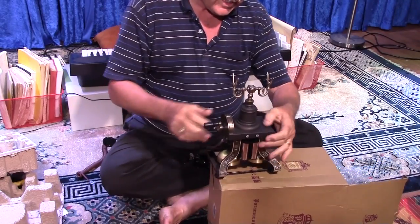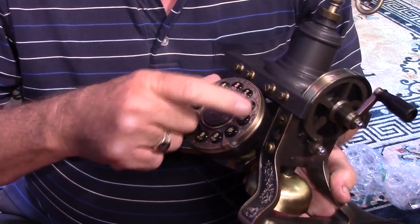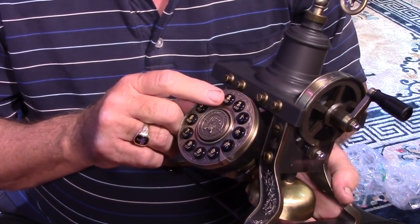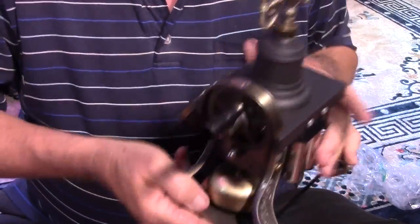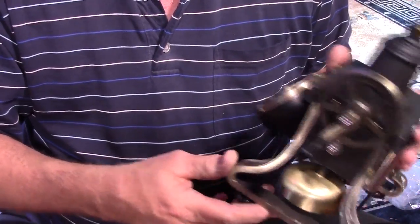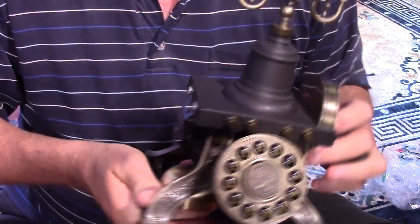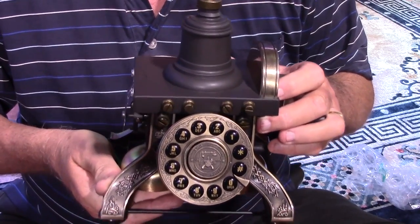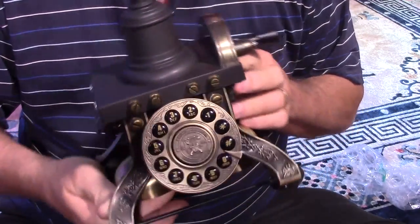This is cute, though it doesn't really do anything. I think that some words are in order concerning the buttons here. Some people have been unhappy about the buttons and wanted a real rotary dial. But we really have to remember that the original versions of this phone had no dial, no buttons — nothing. There was no direct dialing in those days. You would crank the handle, which would turn a generator, sending a voltage down to the office and alerting a switchboard operator that you wanted to connect. Then you would be manually connected to whichever party you wanted to talk to. But nowadays there's no infrastructure for this sort of thing, so we have to have some sort of direct dialing mechanism. Whether it would be a button system or a dial system, either one would be equally anachronistic.